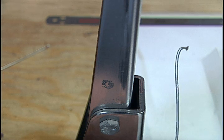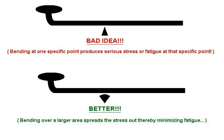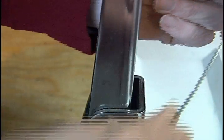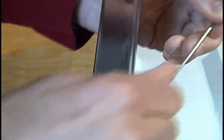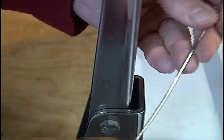When I reuse a spoke, I often have to straighten it out using a bending process for accurate sorting and for accurate recutting and re-threading in a spoke machine. When I straighten out a spoke using a bending action, I do not bend at one finite point — that introduces stress, which equals fatigue. Instead, I spread the bending action out over a larger area, spreading the stress out and minimizing fatigue. You can do this using a couple fingers and a thumb, which have natural rounded surfaces, or you can use a tool that most wheel builders have underneath their own noses already: a Park Tool TS-2 truing stand.